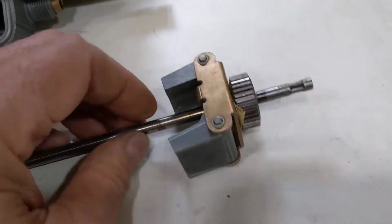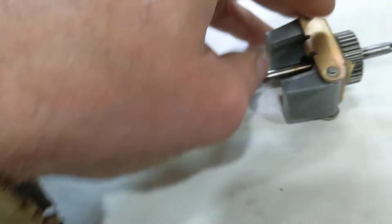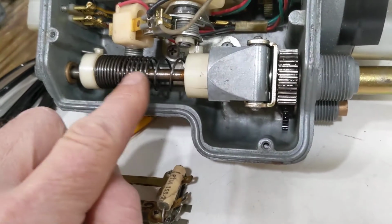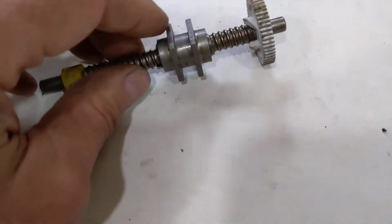So that's that. Here's the centrifugal fly weights. They move in and out. There's lever arms underneath. As it moves, the lever arms work against the coil spring. Coil spring would ride on that. Drop the coil spring right on that arm, and then that's this coil spring here, and then that moves the points. Underneath, it moves the magnet back and forth by the bi-directional motor. Is this item? It would actually be this way.